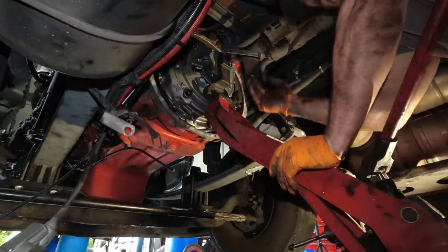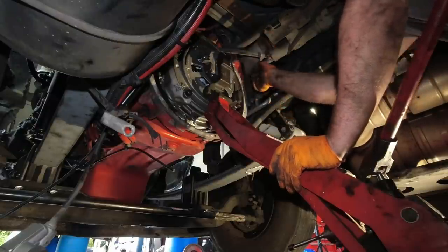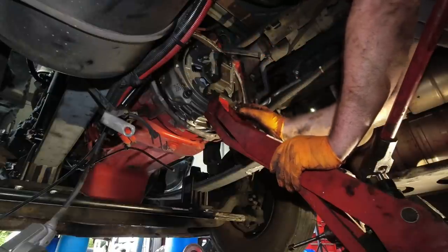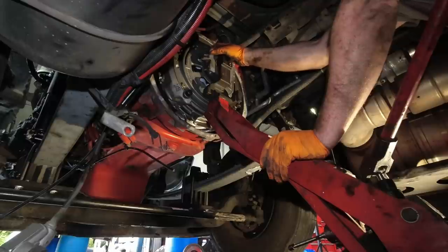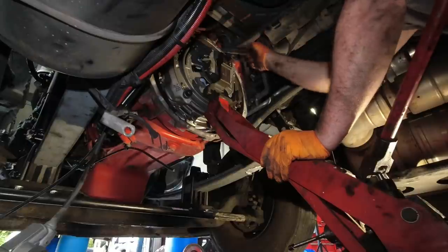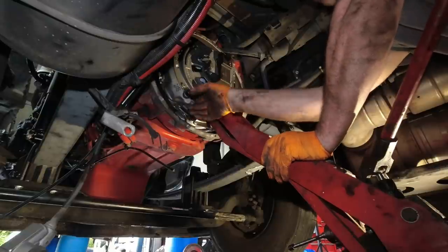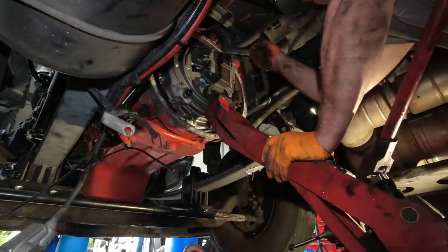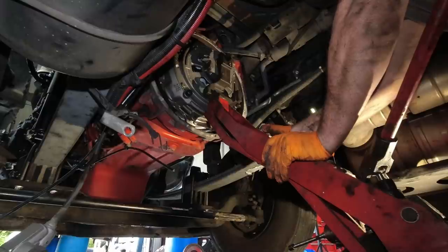Because here's the issue with putting a clutch on a transmission. I cannot picture how it'd be done. Because you just saw how I did this. I crisscrossed it, tightening. You have to do that, otherwise it could push up and not get the clutch centered. Then it's gonna be wearing on the input shaft and wearing your throwout bearing and all this other stuff. So you have to get it centered, and that's why you use the guide pins and everything else. Then you crisscross the bolts and tighten them, and that pulls it in straighter. How are you gonna do that with the transmission? All you got is a little lookout hole that you can stick a tool through, and tighten one. Then turn the motor all the way over, tighten another one. Turn the motor over, tighten another one. That's crazy. So, it is what it is.